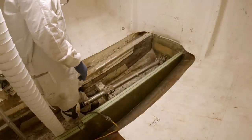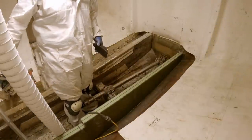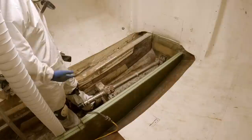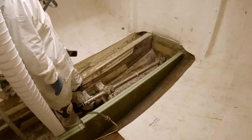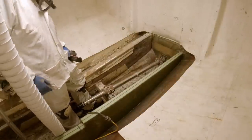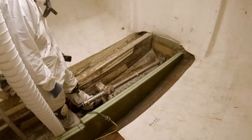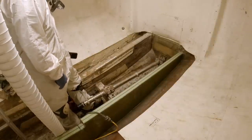Demo begins on the second stringer over here. I just finished glassing in the last of the tabbing on our first stringer, and it would have been plenty of strength beforehand, but I got the clean work out of the way before we start getting a bunch of black wood and grease wood and old glass all over the place.